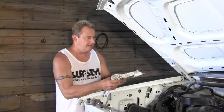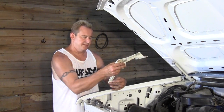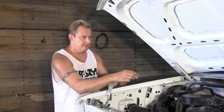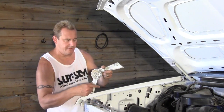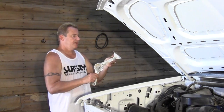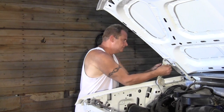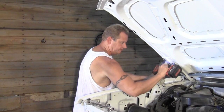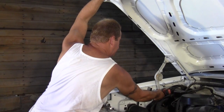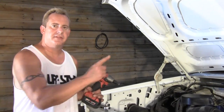So to put these springs on, you just have these two bolts that go up here, and then another one that goes in through here. They all have a 10 millimeter head, so you need a 10 millimeter socket to get all these on. Not real difficult. I don't know if it matters, but I'm going to put the ones on the hood on first because that's how they came off. We'll zippity-doo-dah that one on. Now I'm going to go and do the same thing over there.